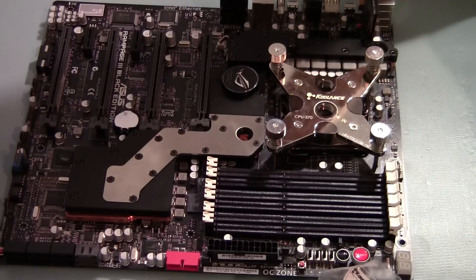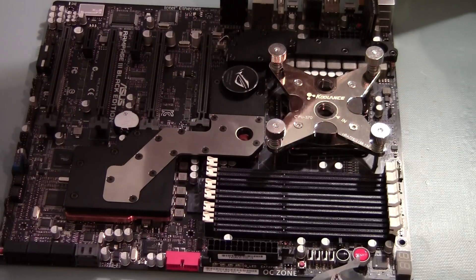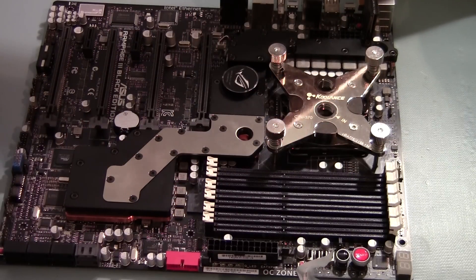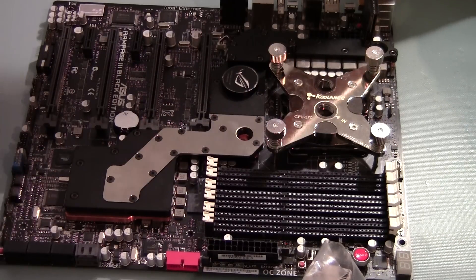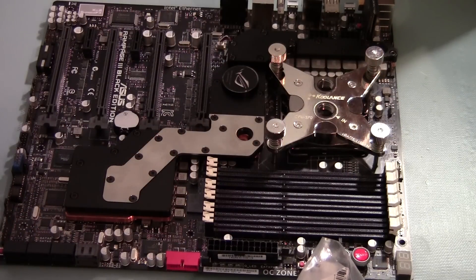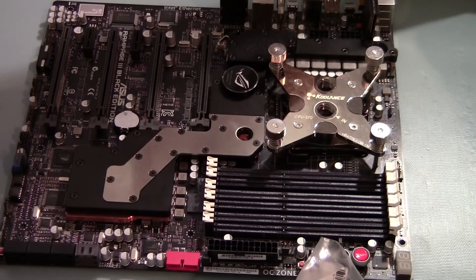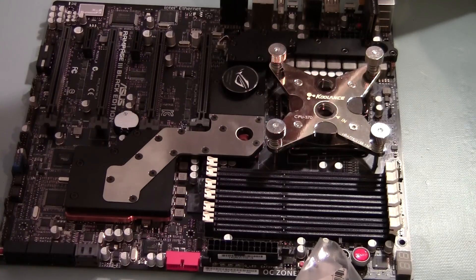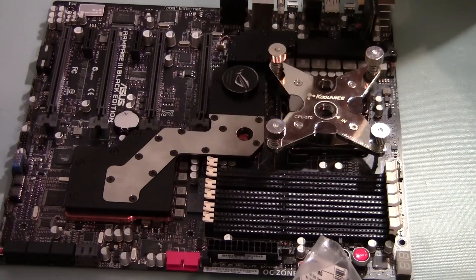The graphics cards I have are MSI Lightning Extreme Edition. They're air-cooled, they're pretty quiet. I would like to get some kick-ass water-cooled graphics cards, but right now these are the best I found and I'm going to be using those. So no water cooling for a second loop — I'm going to use one loop and feed the processor first, then the chipset, and then back.